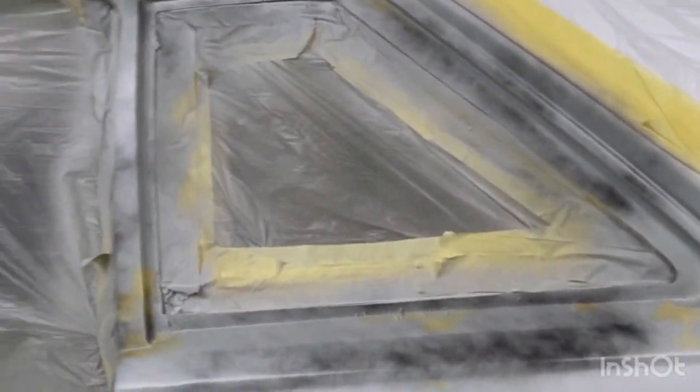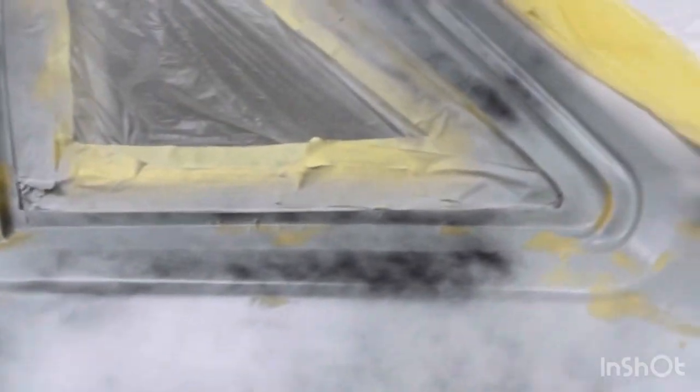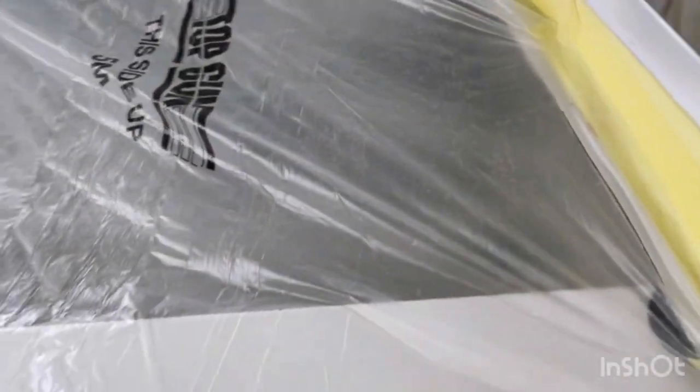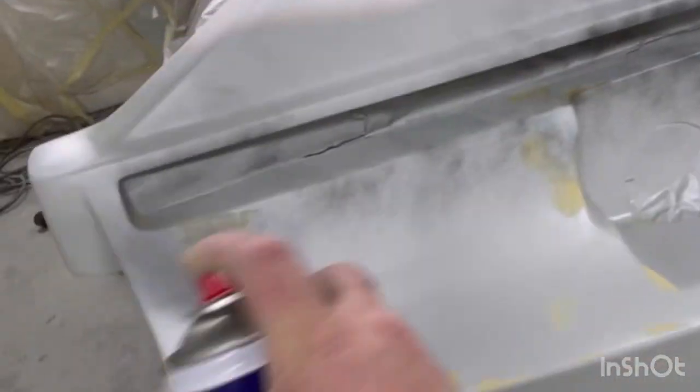I've got original windows for this car as well — two millimetre glass. That extra two millimetres less to carry in weight, it all helps to make the car lightweight. Today they're four millimetre, so you can imagine the extra two millimetres off the glass takes that weight off even more. I've got the original back window with the kevlar opening doors and original hinges as well. So I'm going to get this guide coated up — I'll speak to you on the next video.